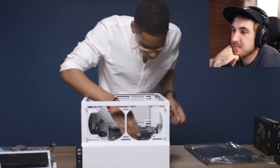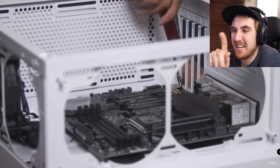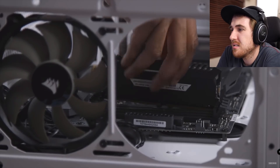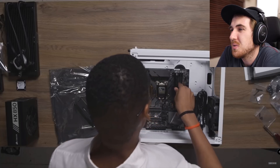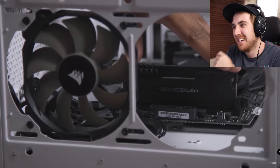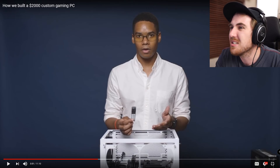We're just going to start installing all eight screws. So next we're going to install the RAM on the motherboard. I chose Corsair's — just aligning the stick with the middle of the strip, not with the end, and just lining that up with the slot. Once you hear that solid clasp and you don't see the gold connector on the side anymore, that's when you have the RAM seated. Oh damn, that's wrong, dude. Just look at the manual. The manual will tell you how to install the memory. It's not that hard — just the second slot, then the fourth slot. It's not that hard.